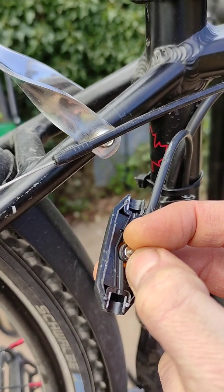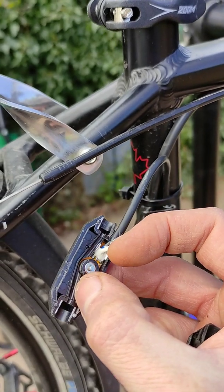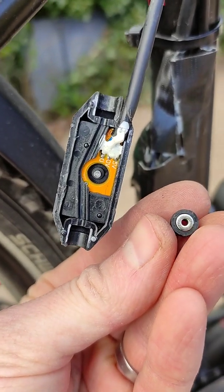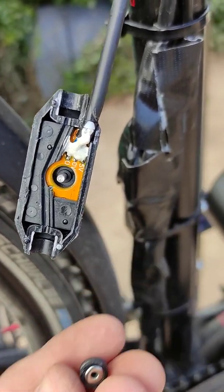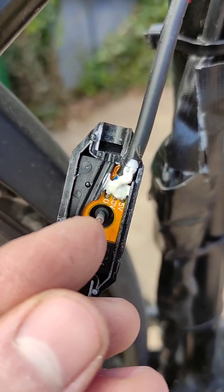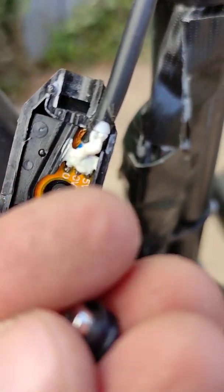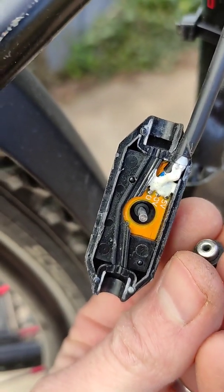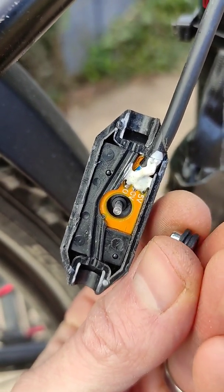It is moving now as you can see as I rotate it with my fingers. I'll show you how it comes apart and how it works. Here's the pulley — I've just pulled off that plastic cover, which also comes off — and in the middle there that silver bit is a magnet that sits over this spindle. As it rotates it detects that and sends a signal back to the motor, very straightforward. So there are two options: one is to reduce the friction between the spindle and the magnet so it rotates more easily.